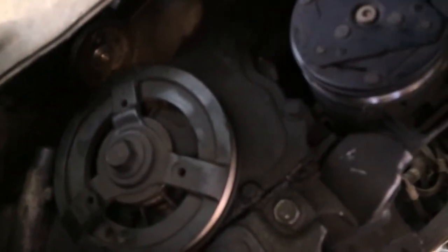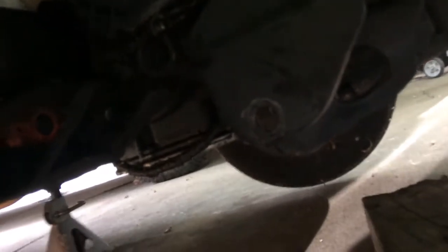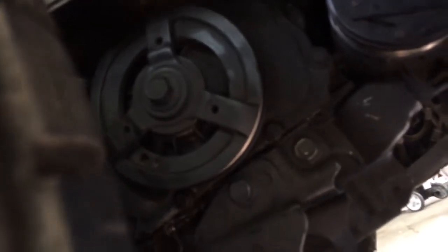What I did is I went ahead and jacked up the vehicle so it's on jack stands on both sides. I'm going to take the wheel off, and with the wheel off you can see there is the harmonic balancer. I already took the serpentine belt off and the belt tensioner off. There's also another motor mount right there — it's like a dog bone that goes mounted from that bolt hole here to that other bolt hole there, so you're going to have to take that off so y'all can lift and lower the engine easier. Once you have that off, you can take off the serpentine belt, the belt tensioner, and access that harmonic balancer to take off the lower timing cover.